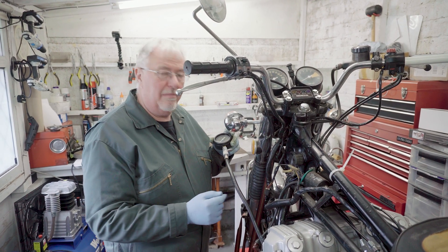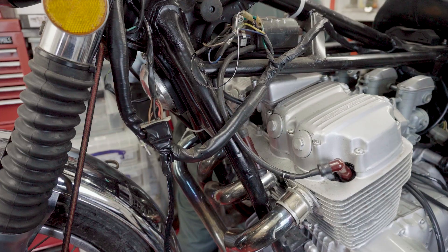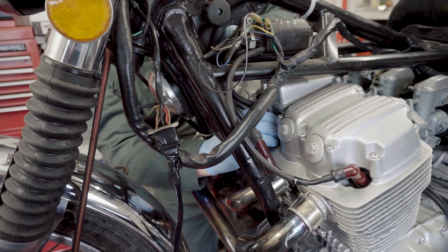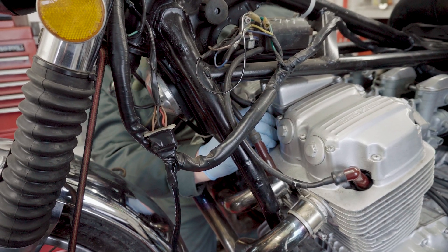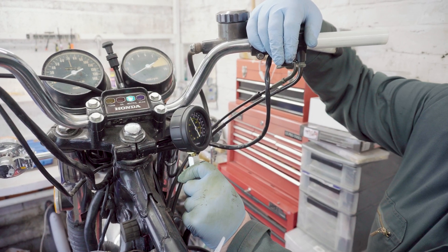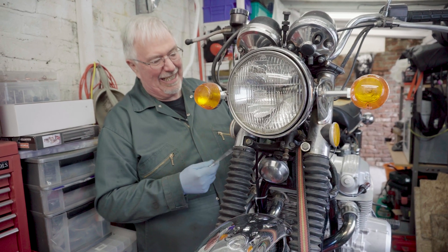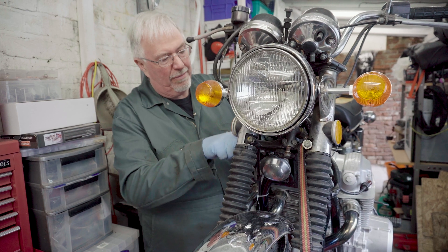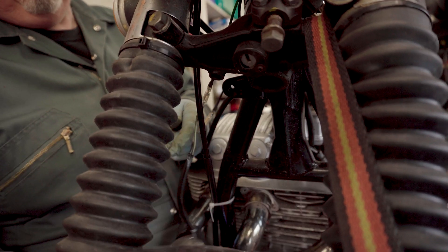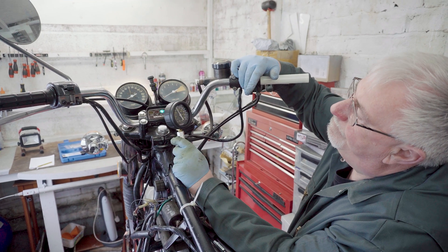Probably about 130, so it's not too bad. I need to take this out, put the plug back in, and then on to number two — which is also 130. Getting the third spark plug adapter in is a bit of a faff because you can't see it and you can't get at it. The horn's in the way as well so I'm going to just whip the horn off to give myself a bit more room.